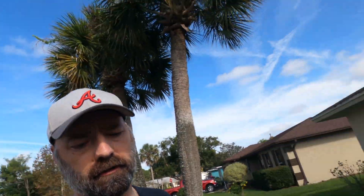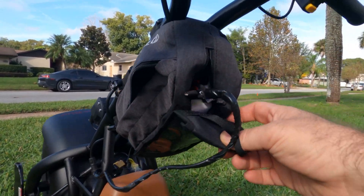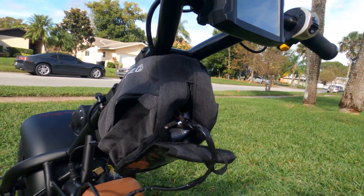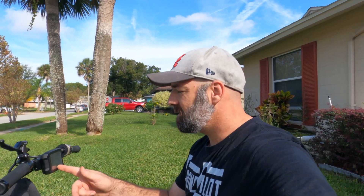I'm getting a weird beeping — uh-oh. I'm out in the front yard with the Super Ride and the battery pack in a bag I bought at Walmart, just for a test. When I turned it on it went a little crazy, off balance, not acting right. What I discovered is the lithium battery was at nearly 70 volts, while this system charges to 67 volts — that two-volt difference was enough to slightly overpower the system and make the computer go wonky. I took a trip around the block to drop the main battery voltage, then plugged in the auxiliary battery and there are no issues at all. It's running just fine. The next video is going to be the range test.